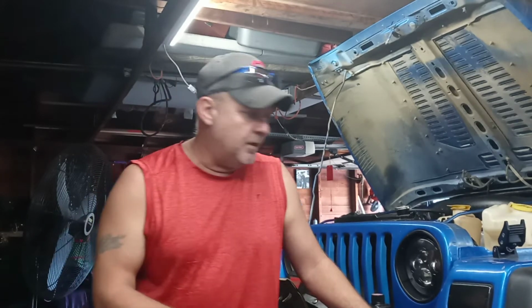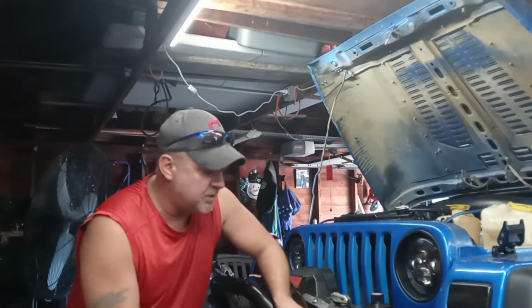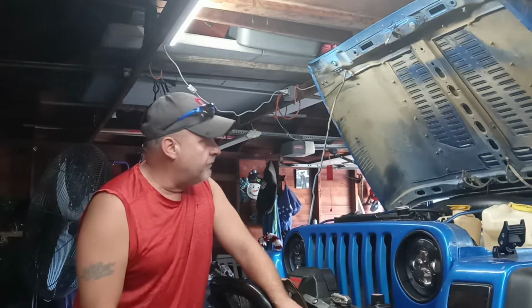But what I would recommend, and I did not do this, but I would recommend for this first startup, is to have somebody out here with a flashlight. If you're in a garage like this, it's kind of dark, because you got to be in the cab when you're doing a startup. But I would suggest having a friend with a flashlight looking underneath, so when you do start it, checking for fluid leaks, oil, your antifreeze, whatever it may be, just to make sure nothing's spraying out or gushing out.